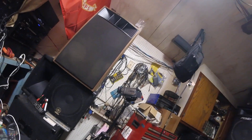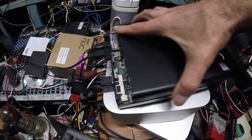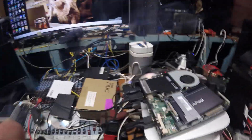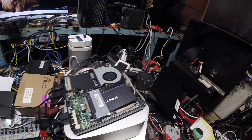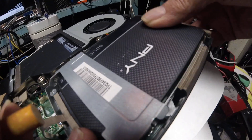There we go, we'll just do it right here. This screw is a thumb screw - you slide the cover forward and it literally comes out. There are grooves in there. Don't force it. Now I'm going to pop the old SSD out.